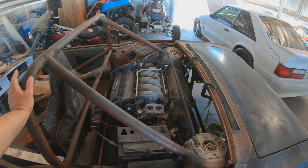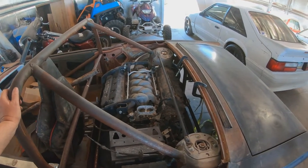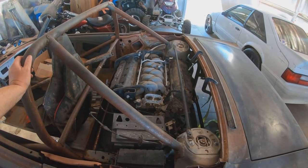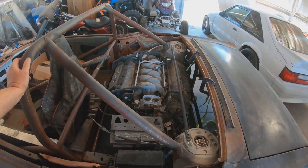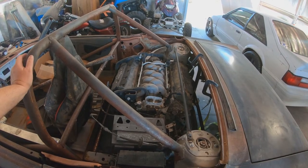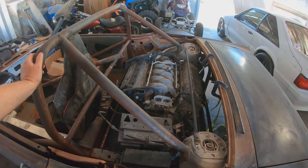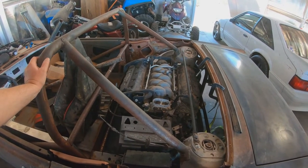And first I'm just going to get it up and running so it moves the car around. Stock has 275 horsepower. The transaxle, which I'm positive will not take more than 275 horsepower before something breaks. So I'll just take it around, cruise it, enjoy it, some shows and stuff, make it look pretty. And then when I'm ready to add the power, I will. It's going to get a twin turbo system, but not set up as twins. It'll be set up as a compound turbo setup once the motor's rebuilt. I will put a turbo on there for the cruising around part though, just so it has some cool turbo noises until I'm ready to build the motor.